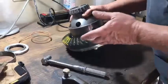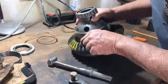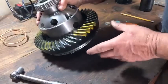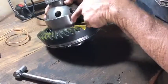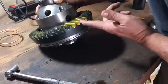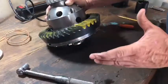Reading the contact pattern: I added a few shims to push the pinion in closer. On the drive side the pattern looks like it could be a little farther in; there's also some touching at the outer edge indicating not enough backlash — confirmed because I couldn't feel any movement side to side. Looking up and down on the teeth, the mark appears slightly high. I'll put this back in and read the pattern again — it's the contact pattern that ultimately tells you if you have a well set-up differential.